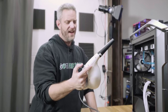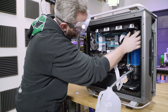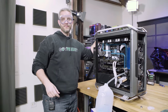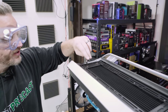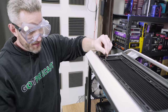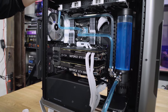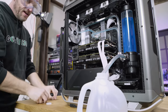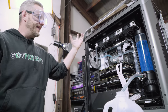This is the computercleaner.com vacuum I got on Amazon — I'll put a link in the description below. I'm loosening the very top; normally I'd just release the top screw on the reservoir, but I can't really get in there. This particular radiator is so thick it has fittings on both sides, so I can just loosen one of these fittings to let air into the loop. And as soon as I do that you'll see it all just start to pour straight out — and there it goes. Fluid out has to equal air in — that's why it's hard to fill and hard to drain if you don't have a proper drain setup and an inlet for air.